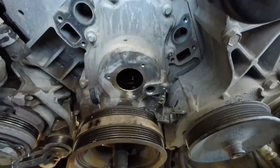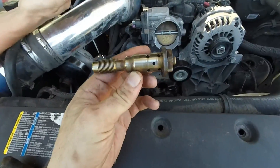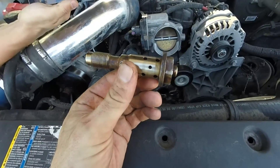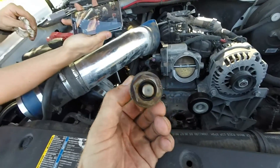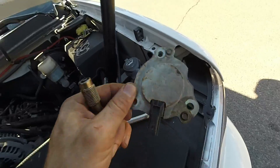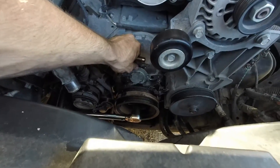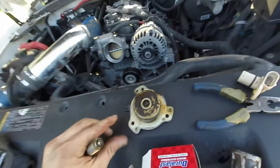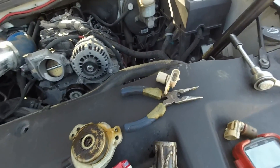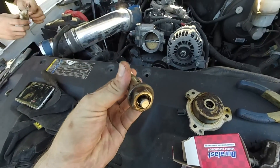I did pull off the water pump, and that goes in there. So this right here is the actuator — not the solenoid, well it is the solenoid, but that's not what actually moves anything. This is the magnetic actuator that goes on the outside of the timing cover, right there. So we're replacing that, the camshaft position sensor, and we just cleaned this bad boy out over here because it's mechanical and it doesn't seem to be sticking.